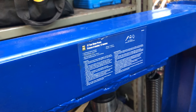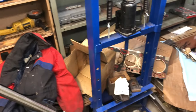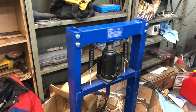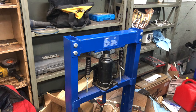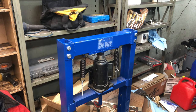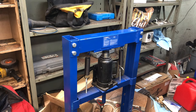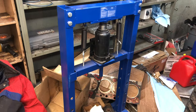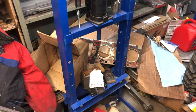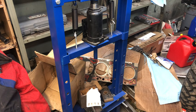This is a Power Fist 12-ton shop press — this thing was so cheap, I think I paid about 80 bucks. This is going to be a pretty critical tool, because the ARB instructions are really good and you have to press some stuff on there. You've got to get the bearings on, and when you're doing that you really have to make sure you're pressing on the correct spot with the right tooling. You might need to fiddle around with some old pieces of tubing — just make sure all your sizes are right.